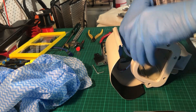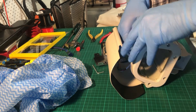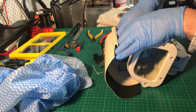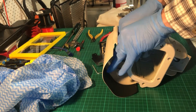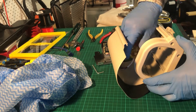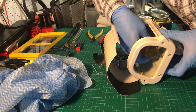This is a bit of an awkward process, which is another reason to do the siliconing later on — you don't have to worry about accidentally smearing silicone onto the window. You'll need a stubby screwdriver to get in and tighten up these screws, and they're quite awkward to get at. Another tip: do not fit the mounting bracket to the camera housing while you're doing all of this. Just fit that on later.